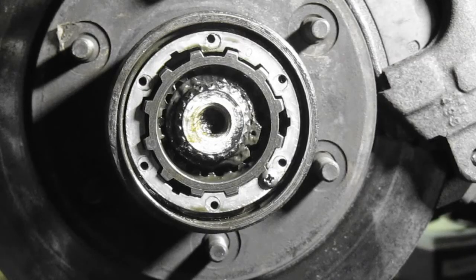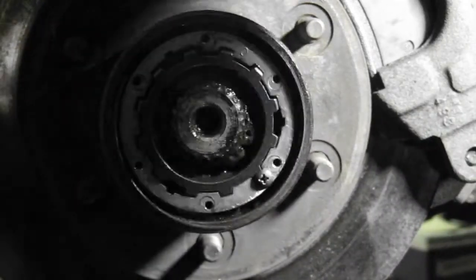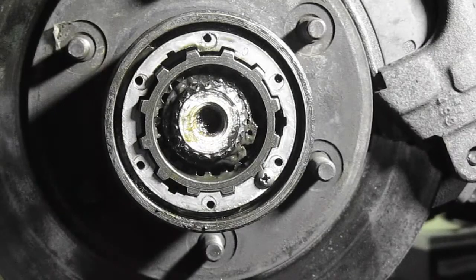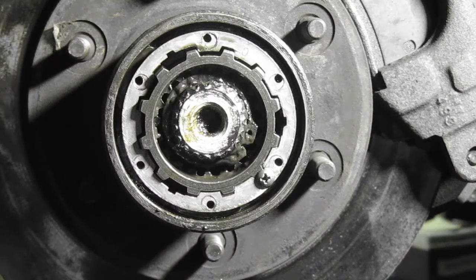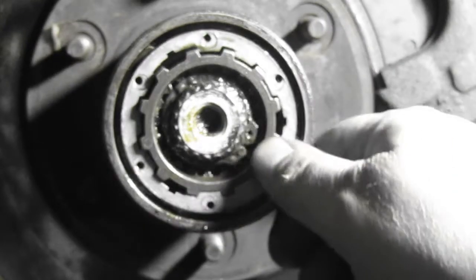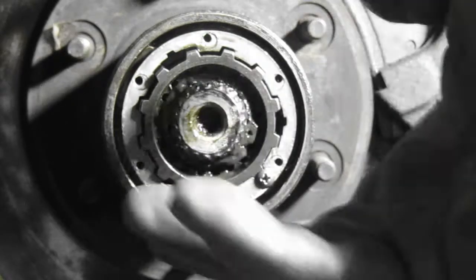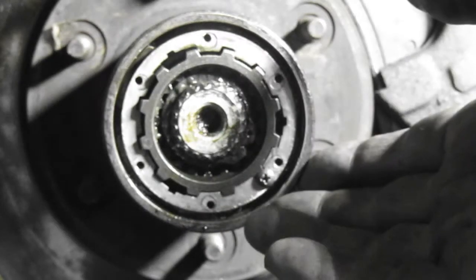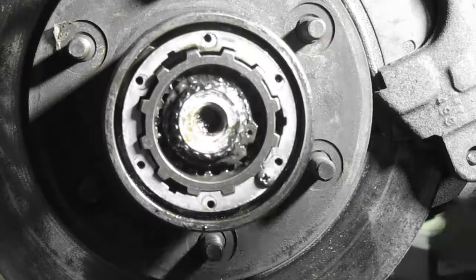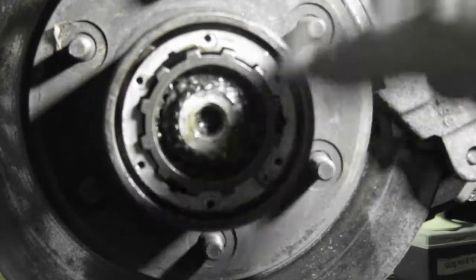See it, Steve? We're rolling. Okay, so take the hub off. When these were Quadra-Tracks, how did you convert them though, even though they had the center cap? They had a block in here, just like you see with the snap ring on it. Here's a snap ring we're gonna have to pull off in a second, and it was basically locked in full-time drive no matter what. When you took your transfer case out of four-wheel drive, you'd have two-wheel drive, but your front end was always moving. But it wasn't locked into the transfer case, so it wasn't four-wheel drive.